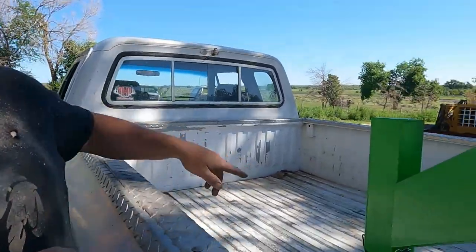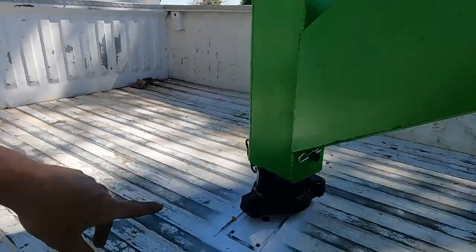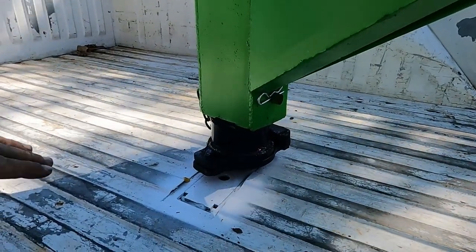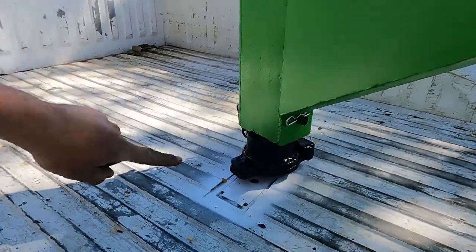We're going to go eat dinner and when we come back, we're going to throw the bed back on it and show you what it looks like when it's all done after we cut the hole out in the middle. We have a gooseneck hitch — obviously we have a trailer hooked up to it right now. We just used it to tow over here and it worked perfectly. All I did to get that hole cut out was, before I put the bed back on, I picked a reference point that would be in the same place after the bed was on so I could measure where to cut my hole. Then I cut it a little bigger than I needed to, to make sure I had plenty of clearance, and that plate is big enough that I knew it would cover it.